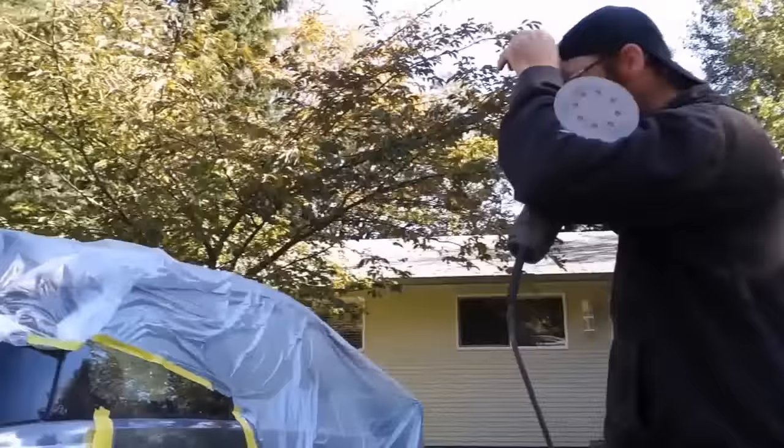Well, looks pretty smooth by now. Pretty good. One, two low spots, but other than that, it's pretty good. Okay, so what do you do with the low spots? The low spots, I'll do another little bit of a skim coat. Okay. And then I'll block that out again, and then I'll do a putty coat, and then we're ready to prime. All right.